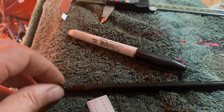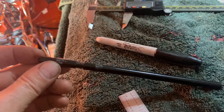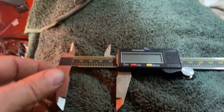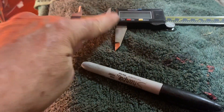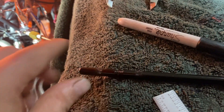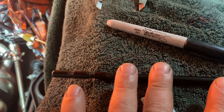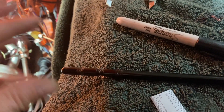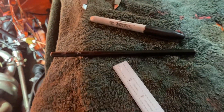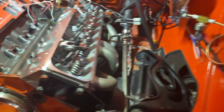I have this special tool — it's an adjustable pushrod. I got it on Amazon for about 20 bucks. I also have a caliper to measure the length of the pushrod. You don't really need the caliper because when it's fully screwed in, they tell you what the length is, and then every one turn is 0.05 inches. So you can count the number of turns when you get it adjusted correctly to determine your length.